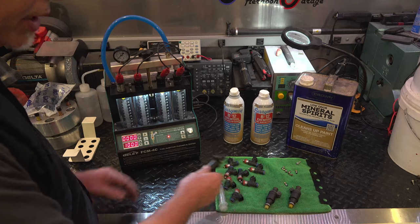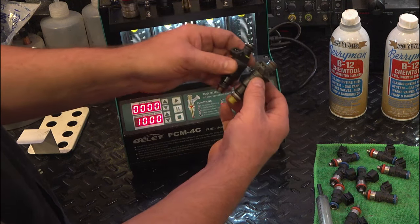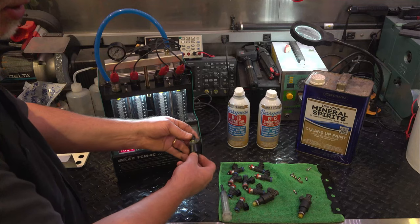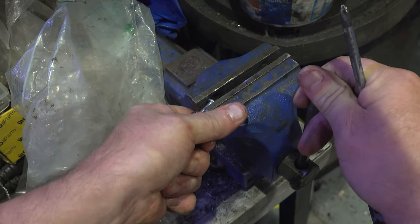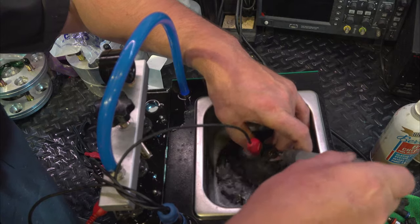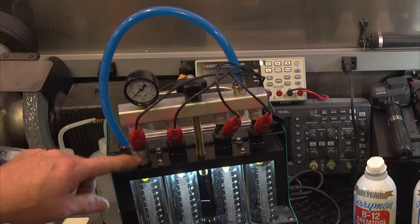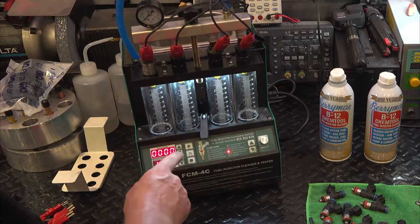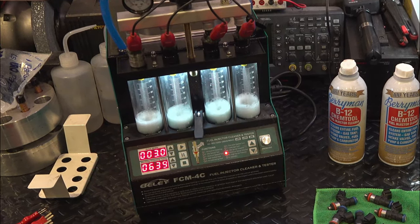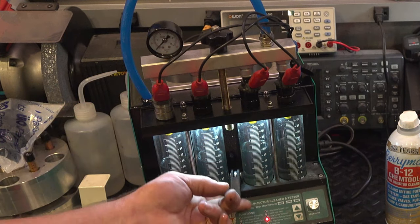It's been about a week or so and I got the new injector. I put them side by side and the body is in a different place, so you can't clamp it down on here to measure individual flow rate and compare. Instead what I did was pop out the screen and give the injector a good cleaning — sucking that hot B12 through it and spraying it right back through without a filter. This ought to clean it up. So now I got the whole thing kind of assembled again. You can see it stripped the paint off this one injector — that's number one, it didn't work at all. We'll start out with a medium spray volume test. I'll throw some more paint on this injector and start assembling that rail.